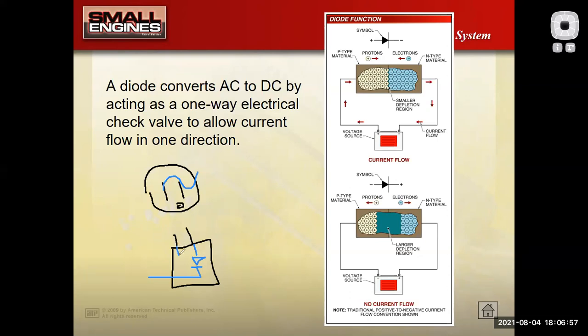It's also going to have some type of step down transformer, because my typical cell phone is running at 3.7 volts. So maybe it's charging at, let's say, 4 volts. Well, I have 120 volts in my wall plug, usually somewhere between 110 and 120 volts from my wall outlet. So I have to step the voltage way down. I have to go from 120 down to 4, and I have to convert it from AC to DC.